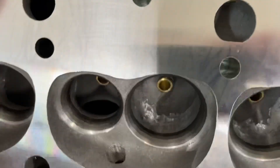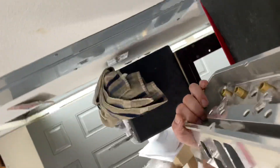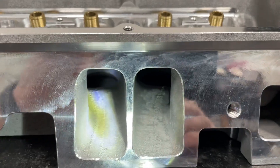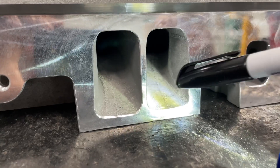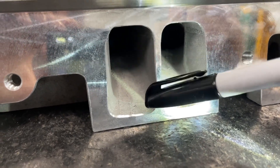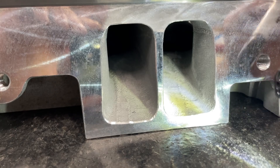You can see the difference looking at one side of the guide to the other - it's filled in. This is the intake port. This part right here where the light's shining is filled in compared to the 195 and even the 210s, so there's more material added here as well. This opening is a 1.206 and this is exactly how it came - I didn't modify it.